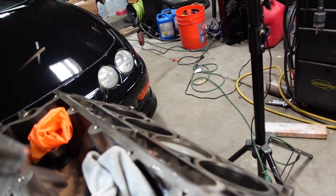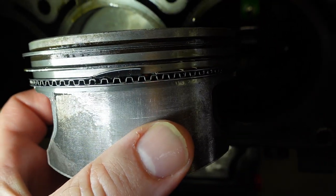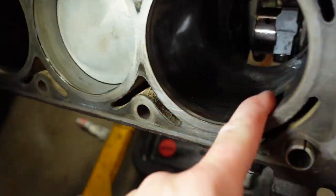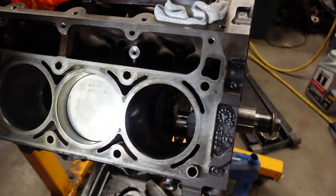I've rotated the engine over a couple times by hand and heard a sound that did not sound right. The sound was probably this — an oil control ring got out of position and bent up going in. And predictably, it has destroyed the bore of the cylinder. If you can hear the emergency vehicles in the distance, they are almost certainly coming for me. That's trash — that's not coming out by hand, that's gonna need to be bored out. New pistons, new rings — starting the whole thing over. Flawless plan.